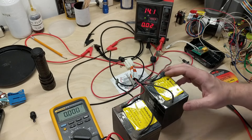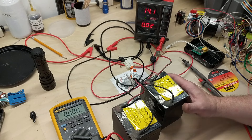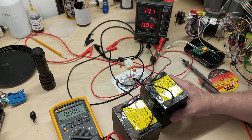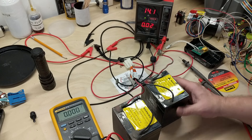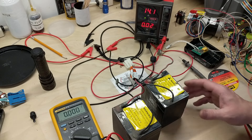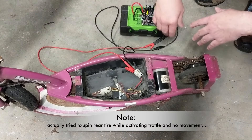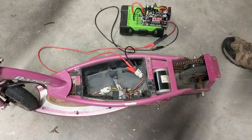At this point it looks like we're going to need new batteries as well as a new charger. The next step is to hook up a 24-volt supply and verify that the scooter will actually run and that everything is okay — that it's worth spending the money on batteries and a charger. We'll see if the motor turns and the electronic speed control still works. We may also have to look into the speed control and see why it's not putting power to the motor, or whether it's the motor brushes.